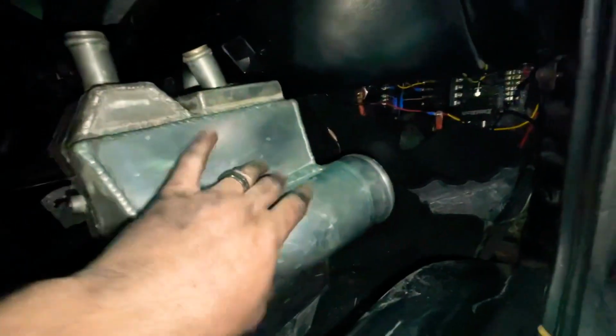Well, we're here working on the hot rod today. Finally figured out which way I think I'm going to mount this. If we come like this, we can straight shoot this, or 90 it and go straight to the throttle body from this side, and I don't have to modify this beautiful piece we built. On this side, I hacked off that pipe because I can turn a 90 or straight shoot it that way, and it's going to go through that little hole down there.